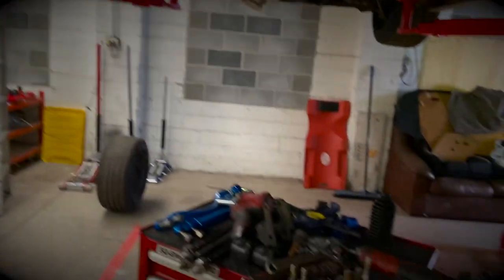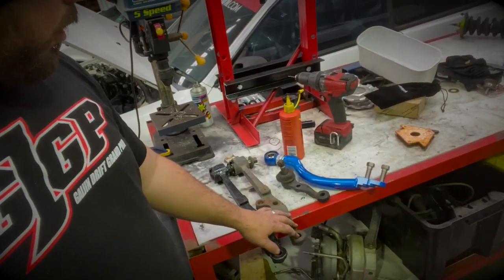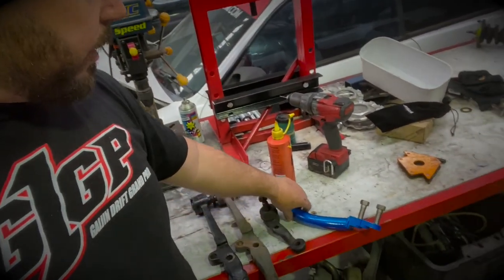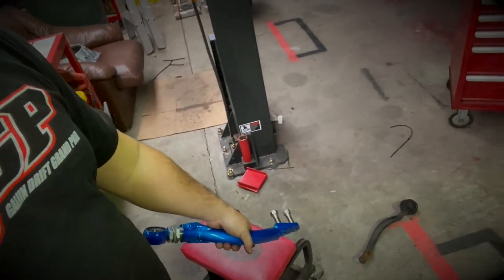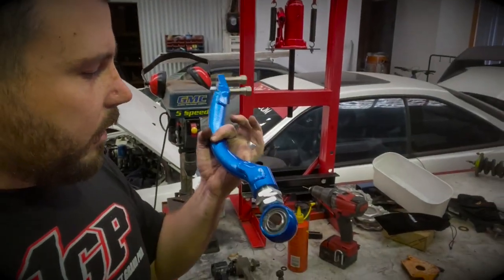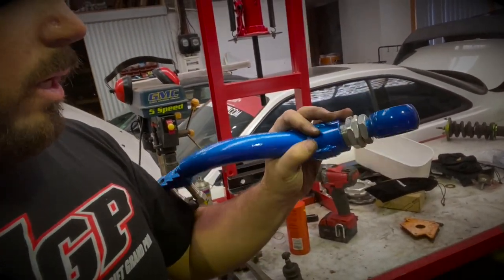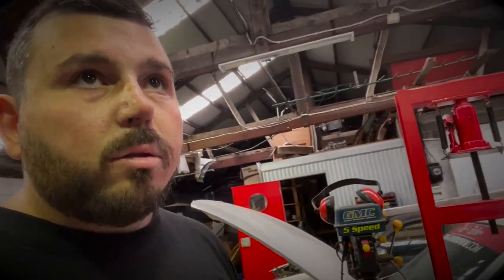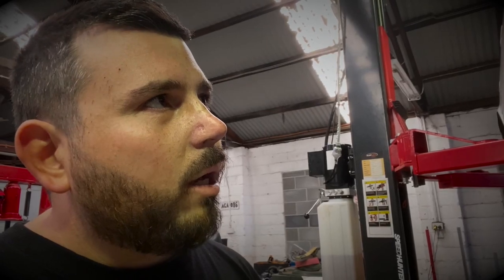She's all out now - nothing in there. Now I've got to make sense of getting all the bolts back in and some new parts. The front right's all apart. The length on the LCAs is heaps longer, which is what I'm after. I'll show you how the knuckles work with these adapters in a minute. I'm just going to make the caster rods the same length as the standard ones - the standard one had offset bushes which is good, but I still want to use these. I can't adjust them because I don't have a spanner big enough to get them undone, so I'm going to go for a drive to Bunnings or Supercheap to get a bigger shifter. I'm just going to do one side today and then call it at that.